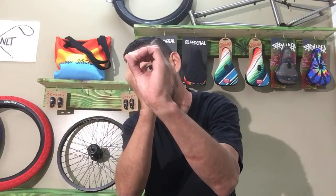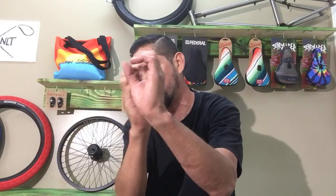Also, I notice a lot of times on the chains, it's kind of like a little, how would you say, peanut shape. So when you put the chain back together, make sure that you can see perfectly straight down the whole of both sides of the chain. Sometimes instead of being perfectly parallel, one will kick sideways like that. You want to get some pliers or something to push those pins straight before you actually put this pin through it.